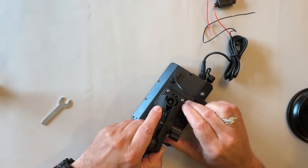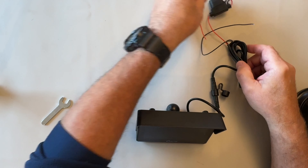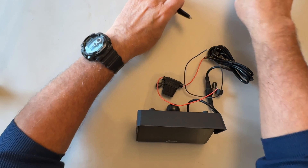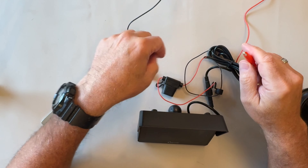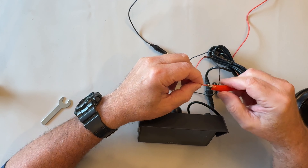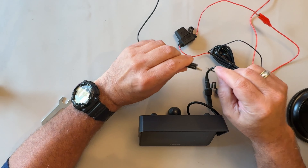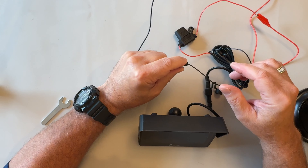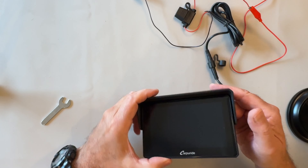So very simple installation. I'll remove it from the bracket just so we can have a look and it'll be easier to maneuver it. I'm going to tie this into the 12 volt power supply which I have right here. I've got a negative and a positive alligator clip. We will hook it up. You would do the same thing on your motorcycle - hook the red to the positive. Then you would hook your black to the negative terminal. Now we should have power to the unit.